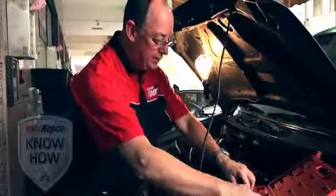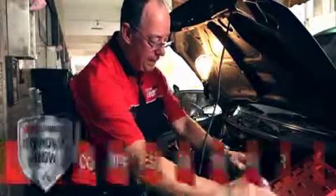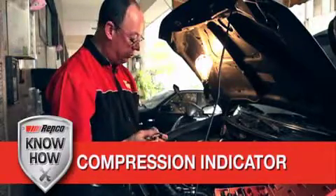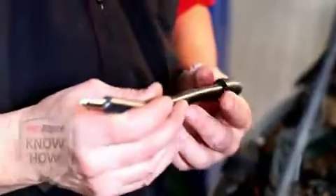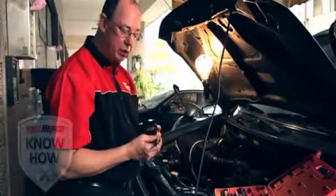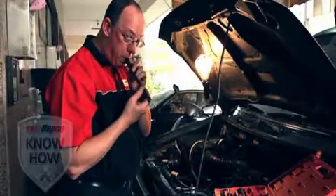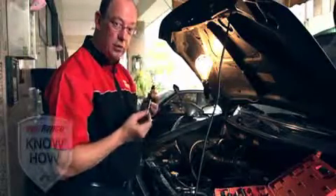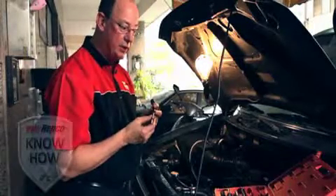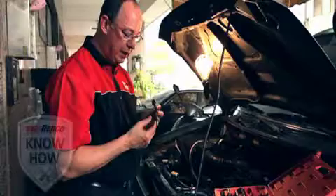The second part of this kit is a compression indicator. This is a great little tool for a quick reference if you think you've got an engine with a sticky valve, an open valve, a burnt-out valve, a hole, or whatever. You rotate the engine by the keystroke, and if you're holding compression, you would get a whistle noise, which means sealing on your valves is good and the sealing around your ring lands is okay — so you've got no issues.